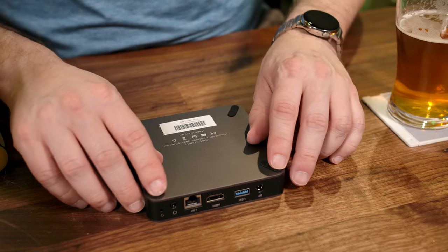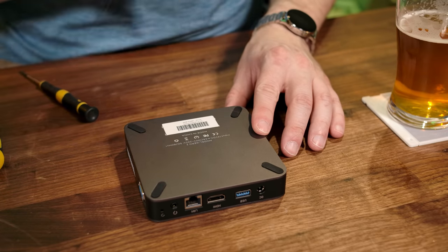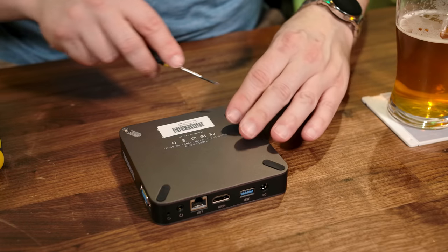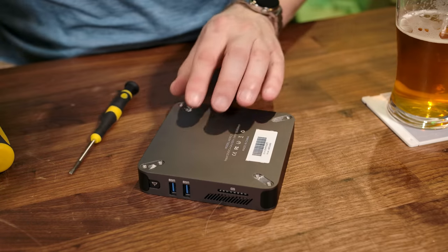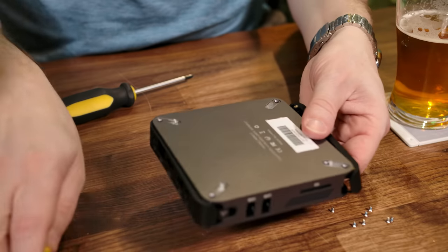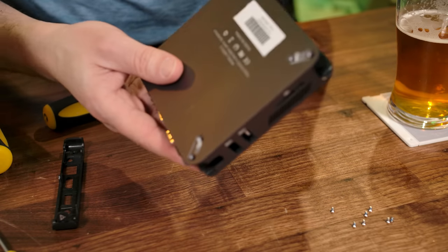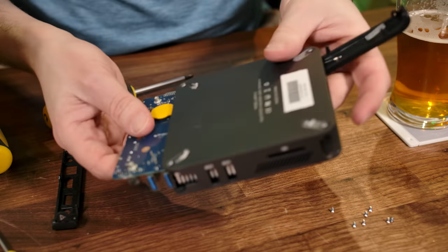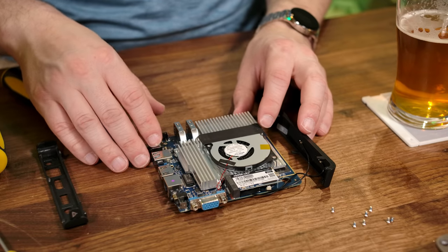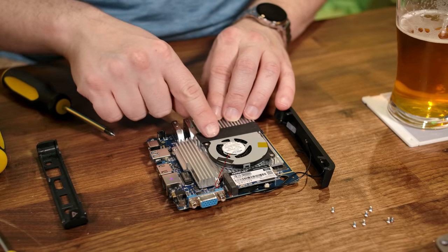Back to the bottom of this case — there are four rubber feet with screw holes on the corners. We're going to remove these rubber feet and hopefully remove the four screws. I stand corrected: there are seven screws in total to remove. The front and rear plastic panels just click right off, and the system slides out just like that. Inside, the first thing I notice is this fairly substantial aluminum heatsink with a pretty nice low-profile blower on it.